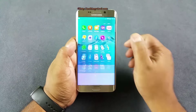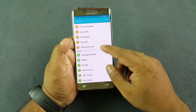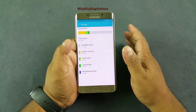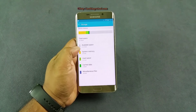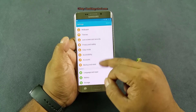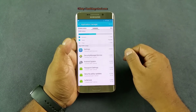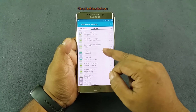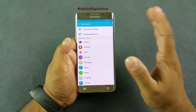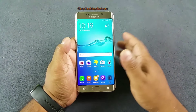This phone is powered by Android Lollipop 5.1.1. It comes in variants of 32GB and 64GB and does not have a micro SD card slot. Out of 32GB, you'll get slightly over 24GB usable. Out of 4GB of RAM, you still have only 1.7GB free with background apps running — that's more than 50% of RAM in use, plus cached apps. However, because you have 4GB of RAM, 1.7GB free is still plenty.